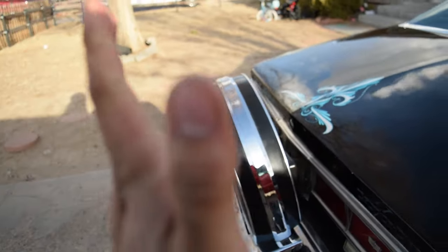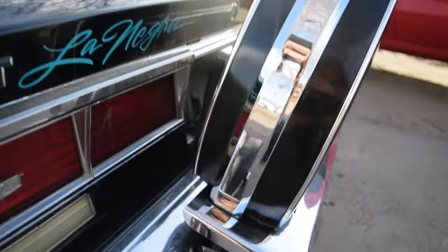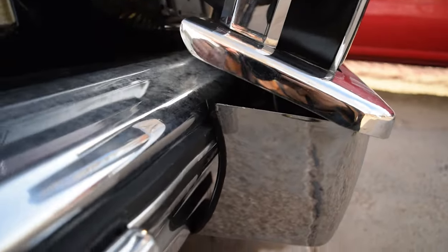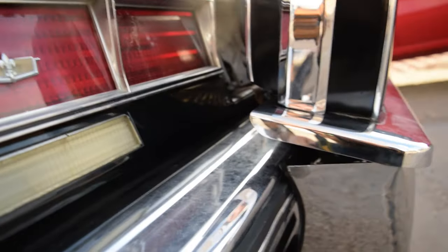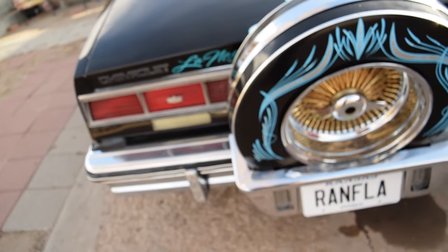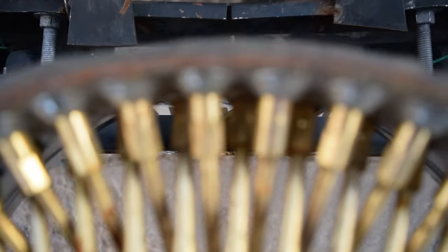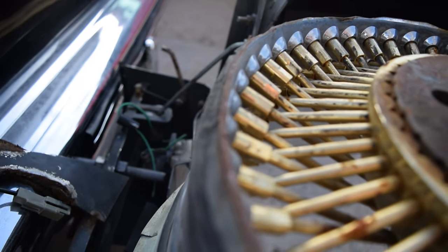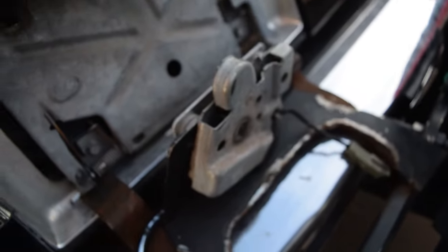To be able to have our fifth wheel here opening and set it down closer — you can see it's got a gap here too. I'm trying to close that as much as possible. It looks like our wheel is kind of hitting, so we might have to shave that or shave part of the frame piece. On the edge of the wheel, it's like a side profile view, but right here we might have to shave this down more towards the spokes or shave it down here — either or.